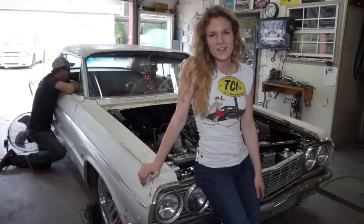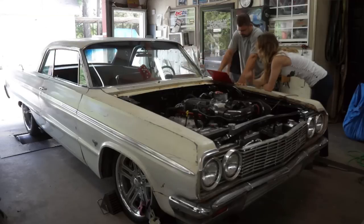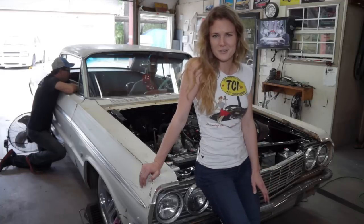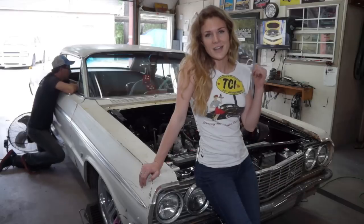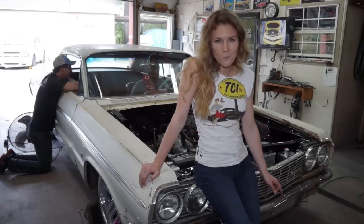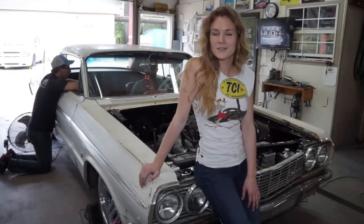Texas Muscle Cars. Had the car on the dyno all morning, and Steven has been checking our tune out, making sure idle, wide open throttle, and cruise, everything is good. All of our air to fuel ratios are where they're supposed to be. Everything's looking good. We're gonna do a final dyno pull. We've got about 6 pounds of boost right now. We're running it really mild. Ann and Simon do not want to go extreme with this car, so we're gonna have an easy tune.